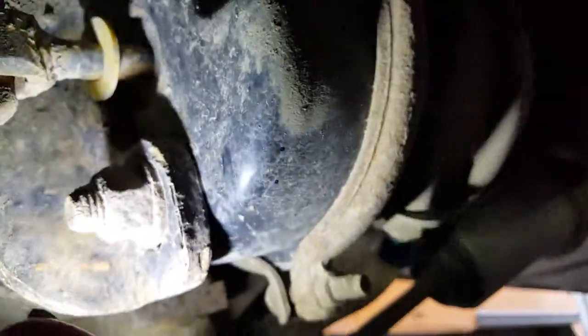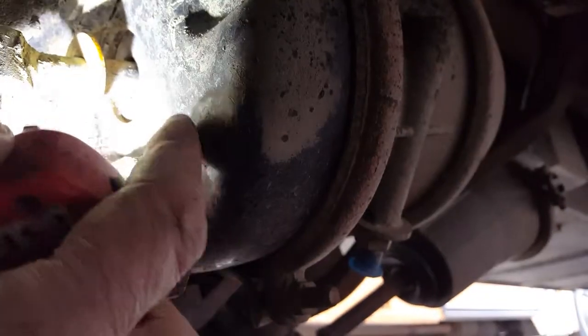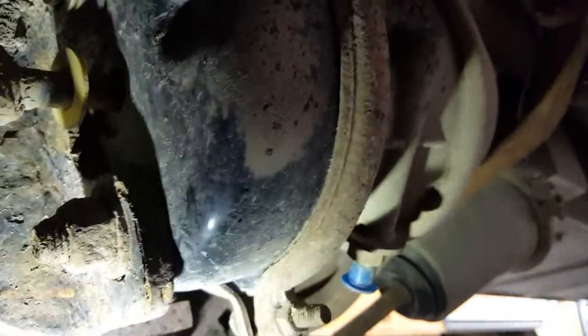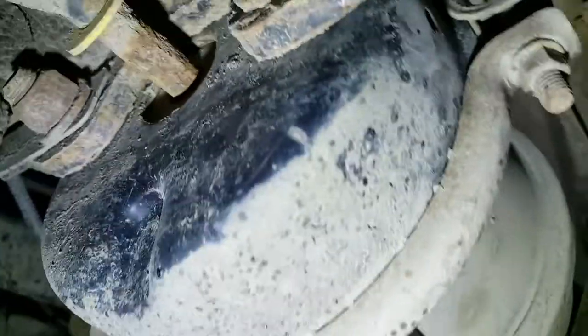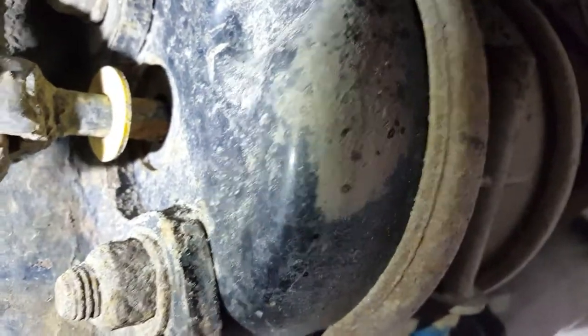So I wanted to show the stroke indicators. You see these yellow plastic discs — they just fit over the push rod. The stroke is measured between the pot and the plastic disc. That's not much — that's nothing for stroke, it's way under the average. And this one here, it's quite a difference. Stroke indicators tell you the whole story. Going by that, it's a sure thing we've got a problem with this one on the driver's side.